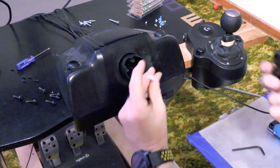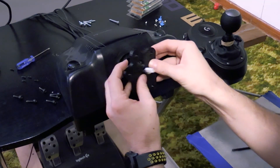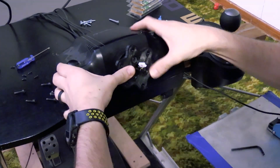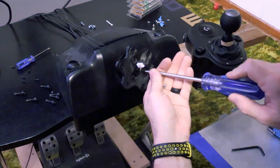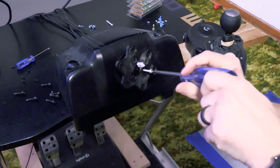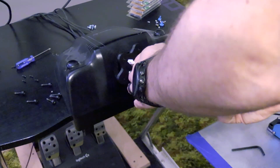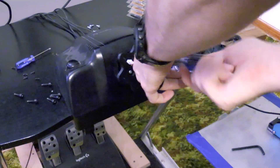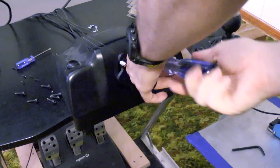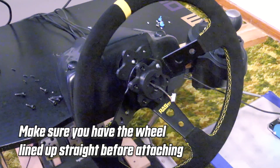Finally we get into the 3D printed pieces. You have to thread the cord with the hook back through that little tiny hole — I had to pinch it sideways to feed it in there. From there, you're just installing your screws through; it's pretty self-explanatory. Reattach it with the screws. At this point it wanted to keep turning, so I turned it all the way — that's what keeps it from spinning every time you twist your wrist. After you get that back piece connected, grab the front piece and your wheel and sandwich the wheel in between.